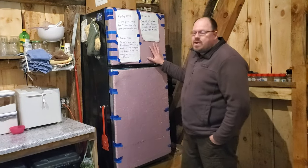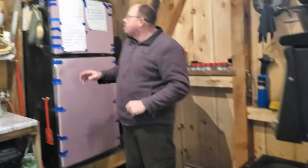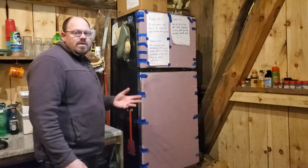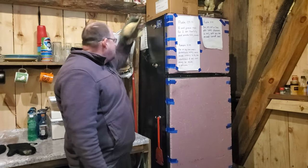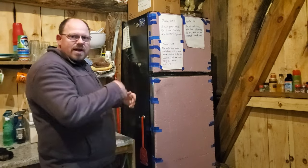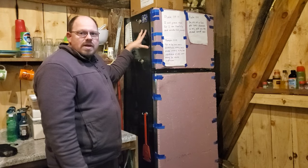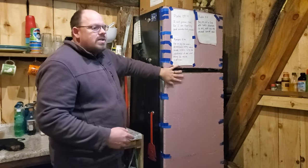This is the fridge we've had for a while. It is directly in front of the wood stove, which puts off a lot of heat. We placed these pink foam boards on here hoping to deflect a lot of it, but unfortunately I wasn't aware of how these things work. After using it for a year, I know now where I messed up. The heat exchanging coils are in the side, right next to the metal — not in the back like the old kind. When the fridge runs, this metal actually heats up. When we run the stove all day, this metal is already warm, so the fridge has to run quite a bit to keep the inside cold, and it's using a lot of energy.